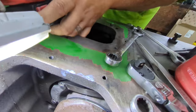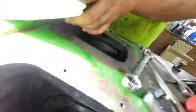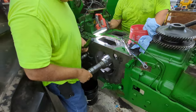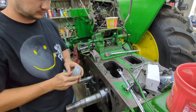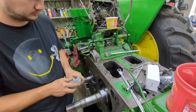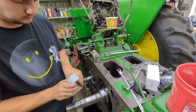It's also very crucial to bend over your tabs against your bolt heads so that your bolts don't back out. So we're putting connecting rods back on now. We've got that side done. You need to torque these to 208 foot-pounds — that's what the book calls for on the rod caps.